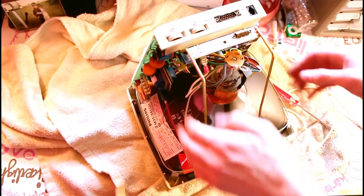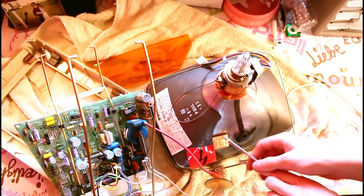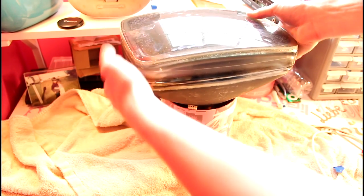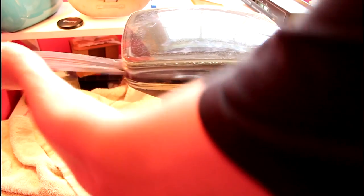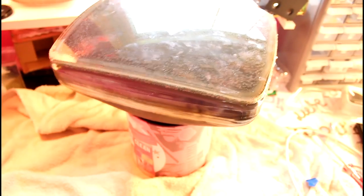Once I've removed the chassis support from the front bezel, I can free the monitor assembly from it. Next, I remove the connector to the electron gun, and the connector to the yoke coils. And once I cut this small wire tie, the CRT is free. Since I have the CRT free, I'm going to remove the packing tape that goes around both the CRT and the protection front glass. I'm also going to shine this really bright light at it to help melt the glue. I leave it on for about 20 minutes.